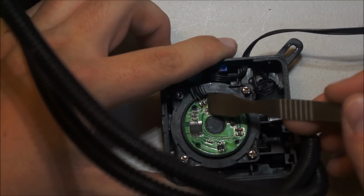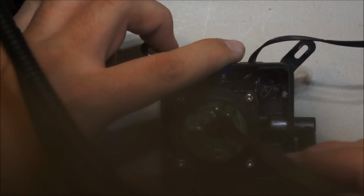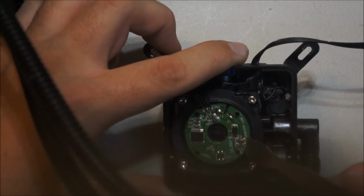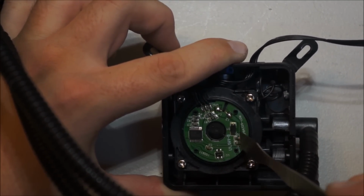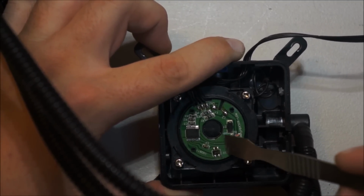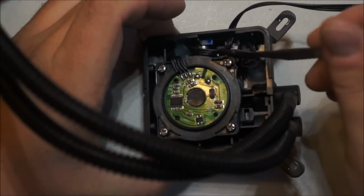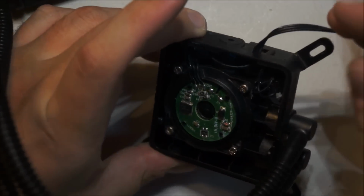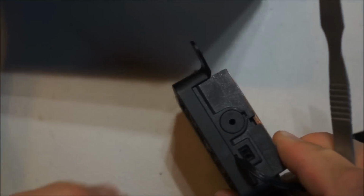These are interesting. You can see these are 0 ohm resistors, so they're just using those as jumpers. Ground, VCC, and FG, which is effectively the tachometer output. There's a big diode. That's a Hall effect sensor right there. You don't see anything else in those 4-lead packages. Yeah. So what I am going to try to do, that actually may not be a beeper. That looks like it goes into the system and may in fact have been part of the filling system.